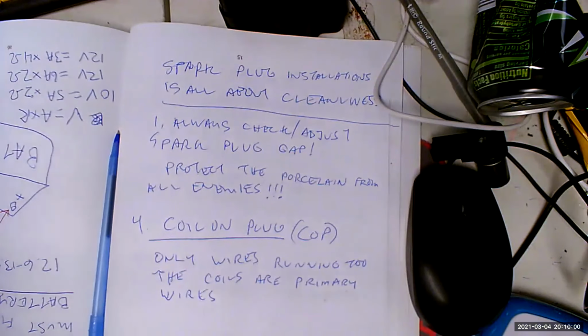I mean, if you get a screw in a tire, are you going to replace all 4? If you have all-wheel drive, you might. Yeah, that's another reason not to get all-wheel drive. But in general, no, you're not. Let's say your right front brakes go bad, are you going to replace all 4 wheels' brakes? No, I would replace the brakes on that axle, but I wouldn't replace all 4.